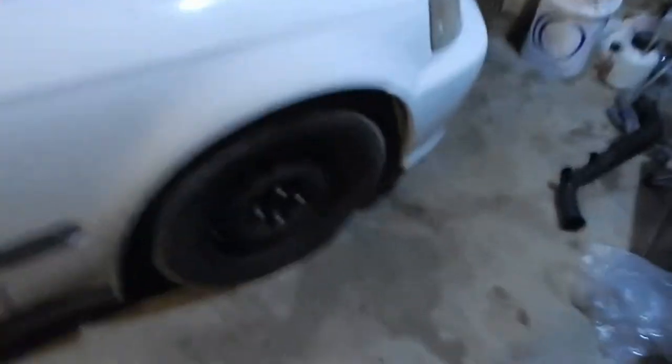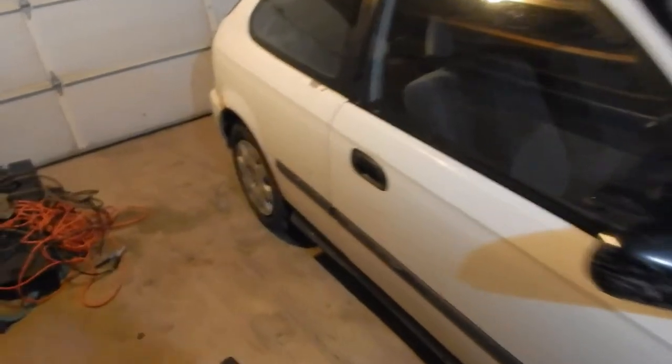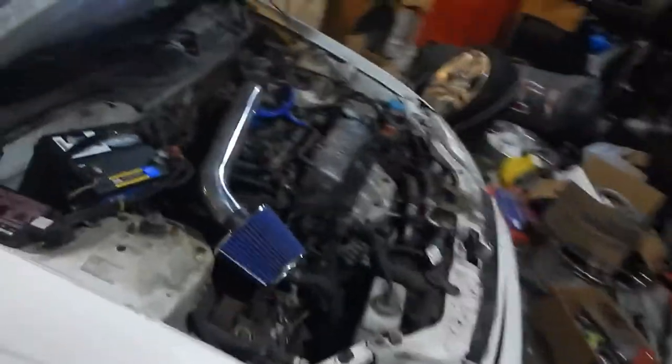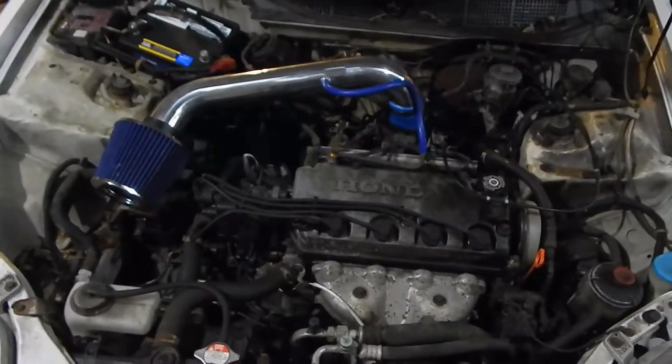I plan on getting new wheels for it, and everything. She's actually running pretty good. I'm also getting to swap all the trailing arms and all the suspension out of an Integra to get it ready for the B-swap. These cars are kind of built like Legos almost — the D-series axles will plug into the B-series hubs, so I can swap all this and still keep this motor if I want to piece it together so I don't have to do everything at once. And then when I swap to my B-series, the axles will fit in those hubs also. Honda's just really easy to work on and really cheap. That's how it's coming so far, so we'll keep you guys posted.